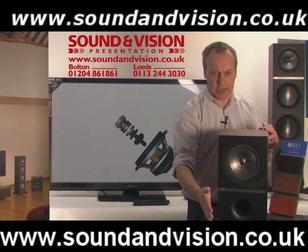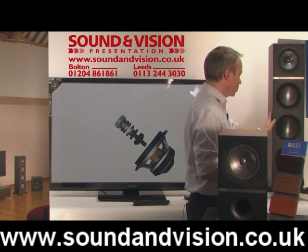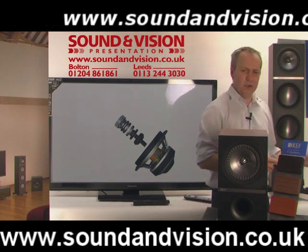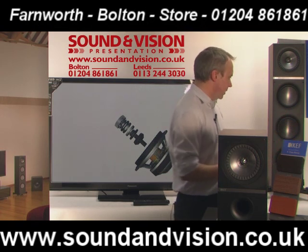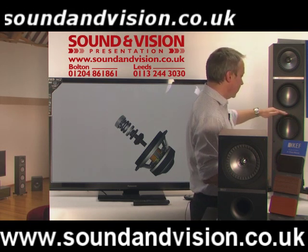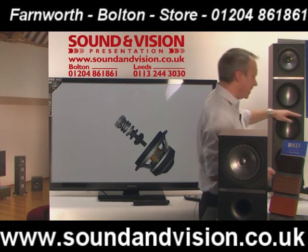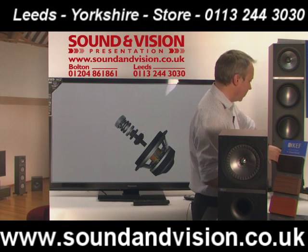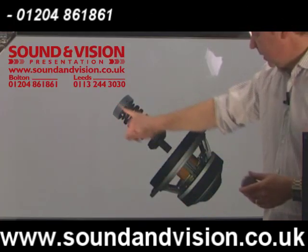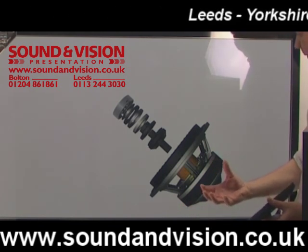The Q300s are actually bass-ported, as you can see here. When you go on to the floor-standing speakers, they're all sealed speakers, with the LF drivers here. When you look at the floor-standing units, the actual drive unit cells are mounted completely separately in the cabinet. The bottom two drive units are in the bottom section, which is actually sealed internally, so the bass drivers are not interfering with the high frequencies.